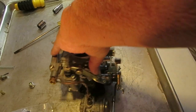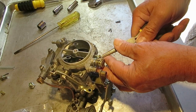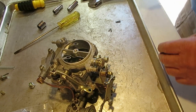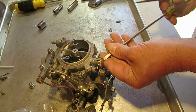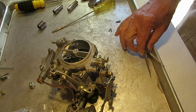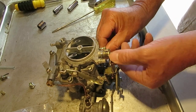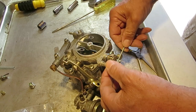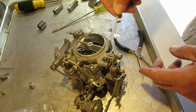One other rod we need to take off to get the top off is this — the fast idle rod. Save all your little clips that you take off. Our kit has the clips in it, but they're easily lost, so save your old ones just for emergencies. You won't have to wait to order one — some of these little parts you can't find. Close your choke partway until it clears the horn and then it'll come out; it's got two little tabs on the end.